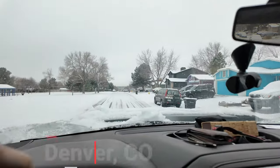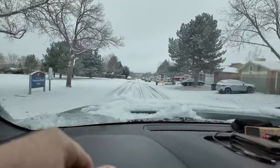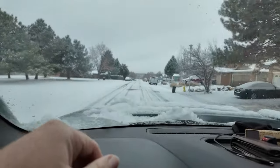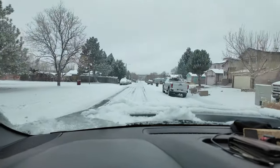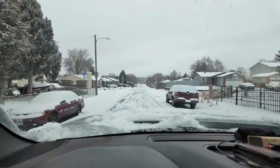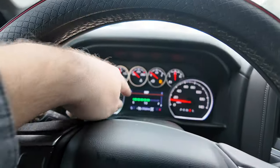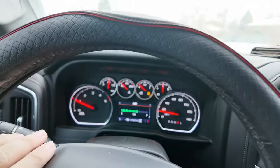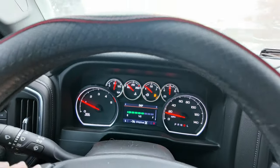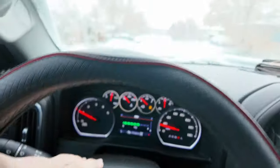We're headed back on the road, now going to New Mexico. It snowed in Colorado — there's a nice little slick bit of ice on the back roads here. They don't plow these back roads, so we're pushing through pretty slow. DEF-wise, we're still a little more over a quarter tank at about 2,000 miles into the trip. I think we're going to make it all the way to Texas — probably get about 4,000 miles out of a DEF tank. We are in four-wheel drive though, which burns more fuel and therefore more DEF. No regen yet on the trip.